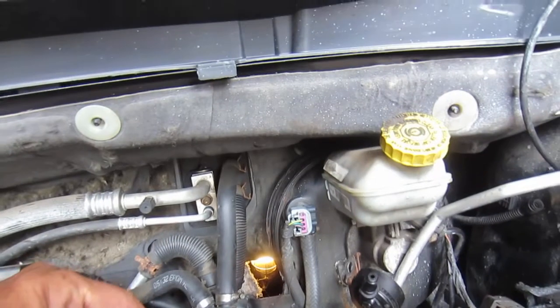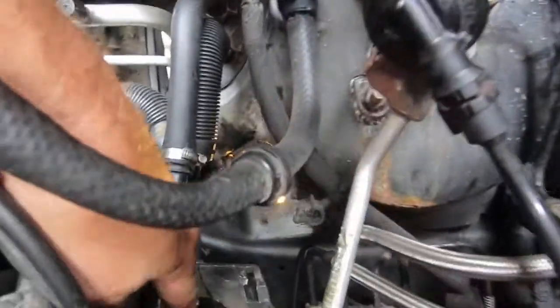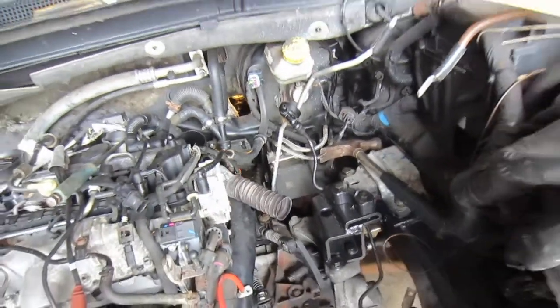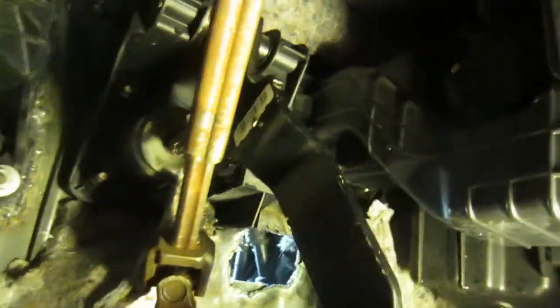The only place I could pull the wires through is there and in that round hole where the gear shift cable for the automatic used to be. I determined there's not enough room to get everything through there. This hole had to be made slightly smaller to get one connector through, and this hole here had to be made two inches by two inches to get the big connector that goes on the ECU, which is going to be under the hood mounted close to where Volkswagen had it. You can see that gear shifter cable hole I just made, with some sound deadening in the way.